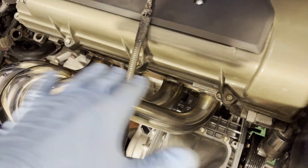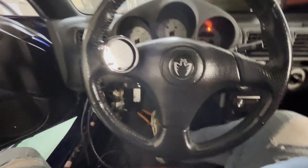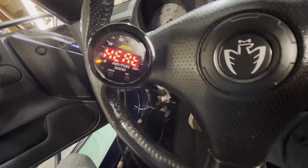We're all hooked up. I just need to get a battery on here and then I'm ready to crank it and see what type of reading we get. One thing to remember — I am still waiting on an exhaust gasket for the head, so I have a huge exhaust leak there and may get some false readings at idle because of it possibly sucking in air. I just want to make sure the gauge works and then we'll go from there. Got the gauge just hanging here on the steering wheel — let's see if it turns on. One thing I actually learned through my research is it has a heater in it that heats it up, but you don't want to preheat the sensor before you start the car because if it gets hot and then blasts some moisture at it, it could shock it and you could hurt it.